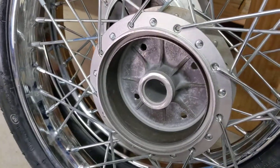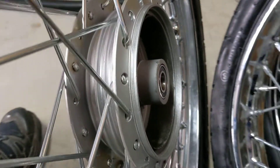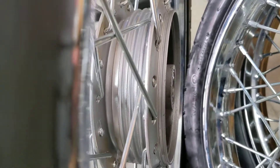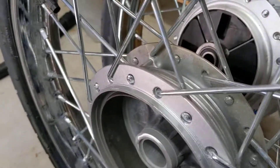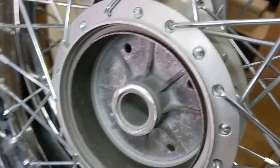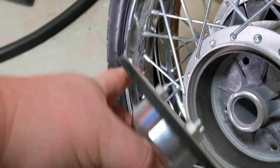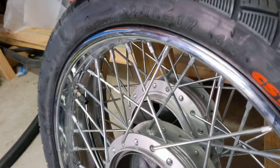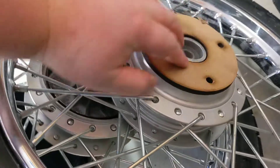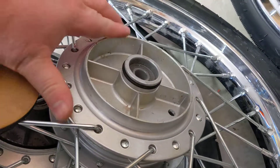Here's the other wheel. As you can see there are some grind marks on the center there — that's how it is normally. You can see that's almost out to the top, which would have fouled on the bolts that hold the hubs. So I got my flapper wheel out, inhaled a bunch of dust, and ground those down, then drilled out the four holes. Now something like that fits neatly on there and all the pressure is being pushed onto that, and then on the other side it fits just like that with all the pressure being put on there.